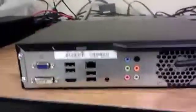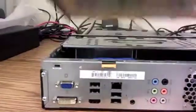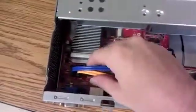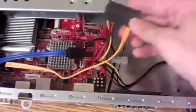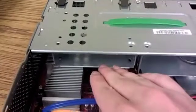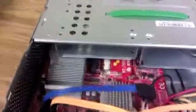Got my two screws removed. I'll pull the case cover towards you and lift it up. So the inside of the case looks like this — the motherboard and CPU are all in one. It's going to have two internal SATA ports with a really cool power-and-data-in-one connector. There's room for one optical drive and one three-and-a-half-inch drive, though space can be a little tight for the three-and-a-half.